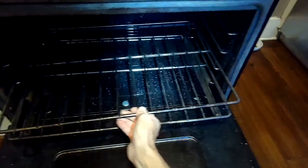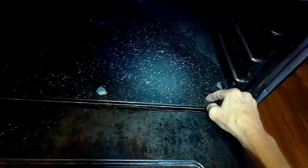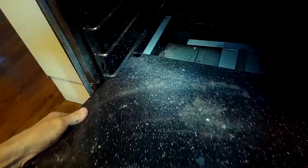Pull out the second rack. The bottom rack comes out a little bit differently — you want to pull it towards you and then lift up so it can slide off. Then there's a panel at the bottom; we just lift up on it a little bit and slide it out. It has a pretty heavy piece of metal underneath it, so you want to support it and bring that off to the side. Then you have access to the igniter.